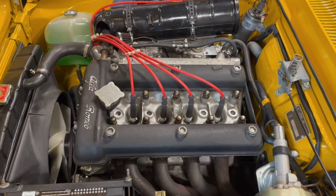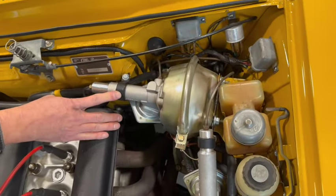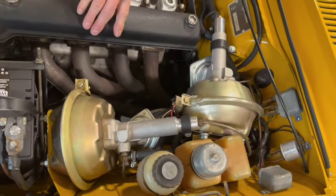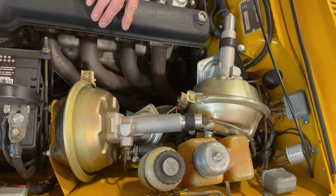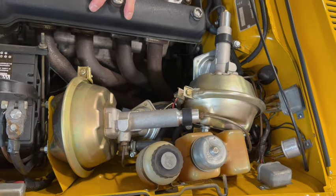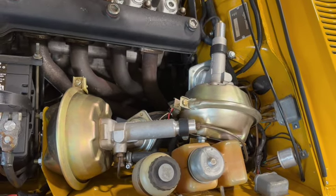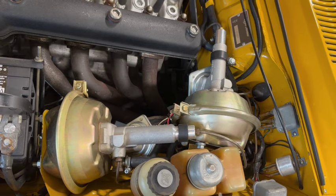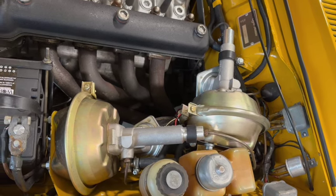They were basically mechanical changes. One of the changes for the Series 2 was the twin boosters for the brake system and the dual brake system, because the laws had changed requiring a backup system in case one brake system failed. So instead of a twin master cylinder, they did two individual master cylinders with two brake boosters. So this must have been retrofitted. I don't believe the '69 cars would have had the two brake boosters, though I could be wrong. That's a worthwhile safety improvement.